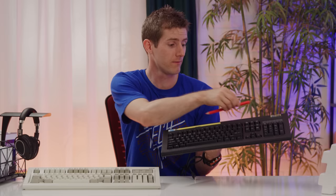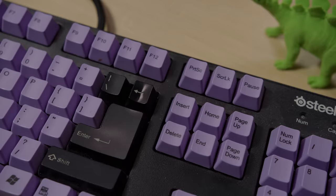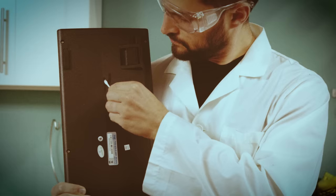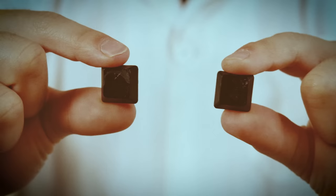The plastics themselves are pretty different. Model M's were made with durable, high-quality plastics, including PBT keycaps. By contrast, both the keycaps and the chassis of the TVS Gold are made of the more common ABS plastic, which can get a polished shiny look over time from the oils in your hands — we confirmed this with a quick acetone test. The white lettering is also coming off, even though the letter outline remains. That's because the legend on the TVS Gold is laser etched, essentially meaning it has a groove burned into the top of the keycap and filled in with a colorant. This kind of lettering isn't the most durable, but it's much better than pad printing, which most budget keyboards use, so it should last reasonably well even in a professional environment.